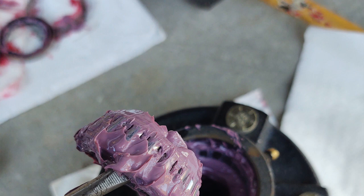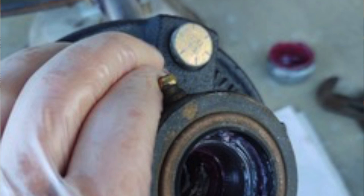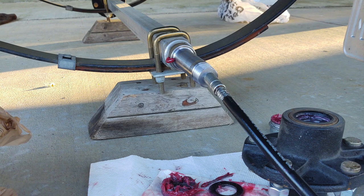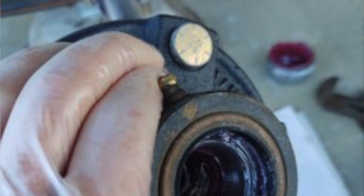John is not the first person to ask me questions about greasing the trailer hub and bearings, so what happened here is probably good for everybody to learn. My concern, particularly for a trailer like mine that has no zerk fittings, is that you don't know what condition your bearings are in or what condition the grease is inside the hub. It looks like C.E. Smith has decided that putting zerk fittings on the trailer hub area and the spindle is a great idea — and it is. However, you are applying grease and then no new grease is added until you apply more, which means you have to take that dust cap off or go around to the back side of the trailer wheel. I'm not 100% comfortable with that.